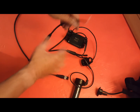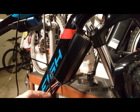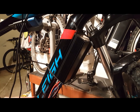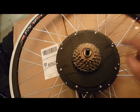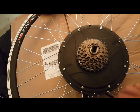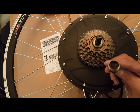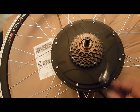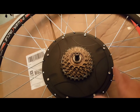Here are my connections for my battery. You can connect any kind of adapter you need for the battery. What's great is it eliminates those bulky controllers and all the wires that have always been something to struggle with — where to put them, how to organize them. All of that is built into the wheel itself. It's a 35-amp controller, very powerful, connects with just one plug. It saves connection time and setup time, easily cutting 30 to 35 minutes off of that.